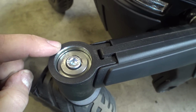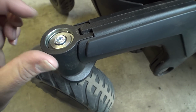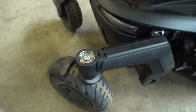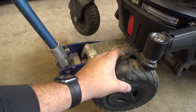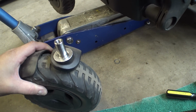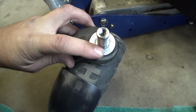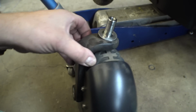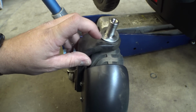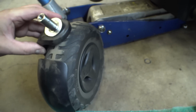Yeah, it kind of looks like we've got some O-rings or something. I don't see the clutch mechanism that they used to run in here. Well, let me get that Allen bolt out of there and let's see what's going on. The investigation continues. I threw the jack into this thing. Oop, we got a little spring washer. So here's our slightly out of round machine surface here. This looks like a cast part, so it looks like they cast this arm and then surface ground it to be flat. That's why we've got this little warp right there or whatever.